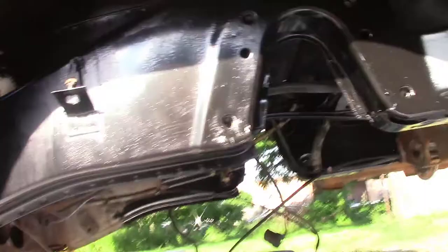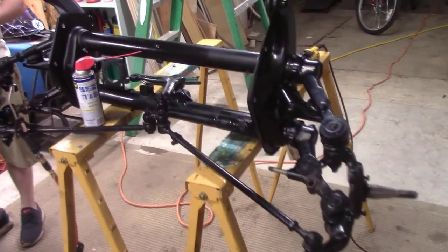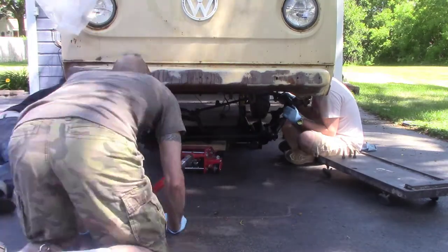Here's the finished product. It's hard to see because the sun's shining in through the back, and the paint is dry so it looks much glossier than it really is. It's the semi-gloss POR-15 paint, which is a little bit flatter. Just like in the part two video, it's brushed on. I prepped it with degreaser, power washed it, and the metal was completely clean and free of grease. I painted the POR-15 on the axle and the beam itself — you saw all the prep work that went into it, so we had a great surface to paint.